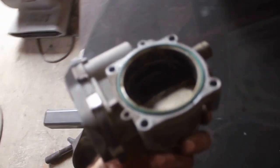There's your throttle body gasket, which I highly recommend you replacing it and replacing all your gaskets. And the electrical connection to the throttle body - I didn't even need to use a flathead. I just pushed down real hard on this area and it lifts that other side up to where it unnotches and then it pops right off. It was a little bit of a fiddle but it wasn't too bad.